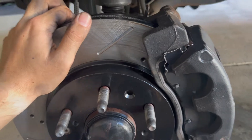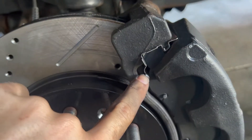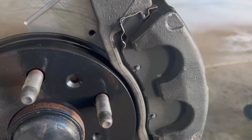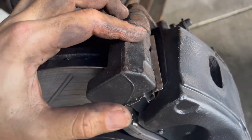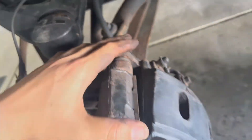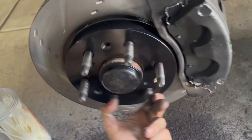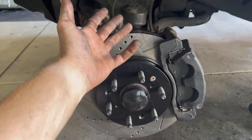Take your shoe, put the supplied clips in on both sides, and slide your pads in. First, put on the shoe and tighten it down with the bolts. Next, put your caliper on — it just slips right over. Compress these little pieces with just your finger, put it on, and you're all tidied up.